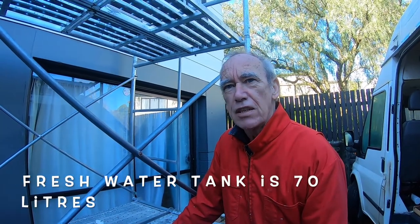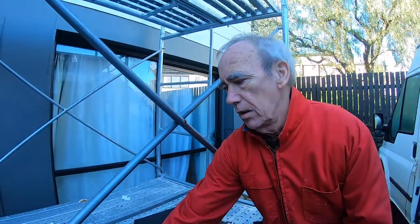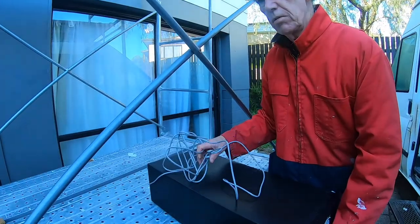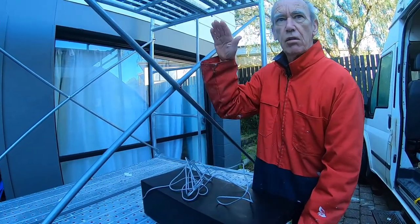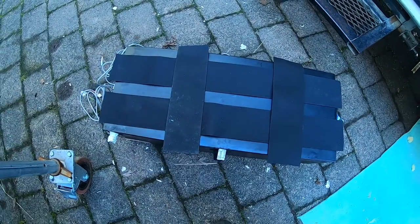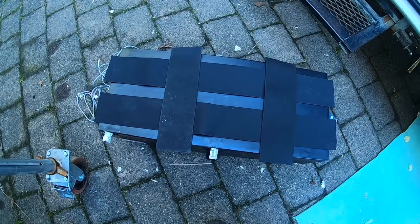For the certified self-containment, if the waste tank is smaller than the freshwater tank, you've got to have a monitor — a gauge inside it. So I've got the same gauge as in the freshwater tank. This will show us as the tank fills on our monitor. I've placed rubber strips on the top of the tank and moved those into position so they go in between the cross members and the tank so there's no rubbing.